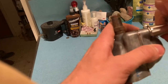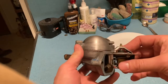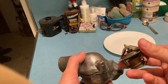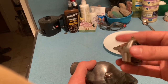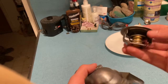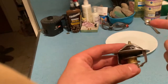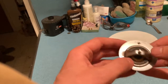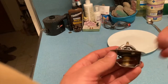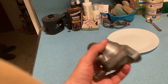I'm not doing that yet because I haven't put the thermostat in - that goes in here. I'm doing this just to test it, to flush out the system, then I'll put it in. If you put the thermostat in a pot of water and boil it, you'll see the spring contract and expand as the temperature changes - it'll open up and let fluid through once the engine gets to a certain temperature. Pretty awesome.